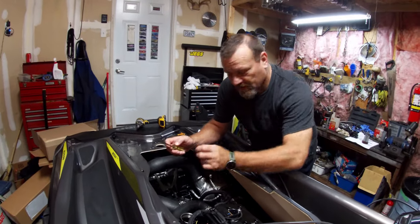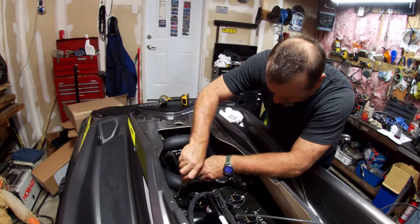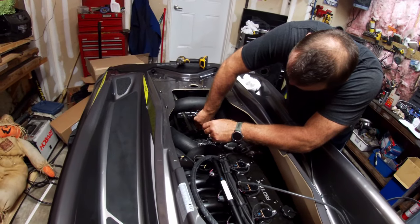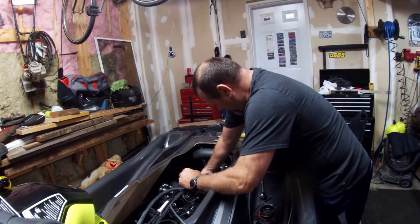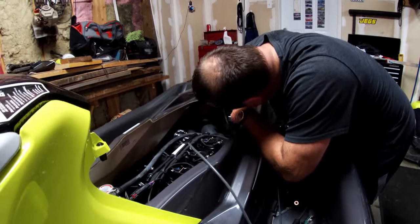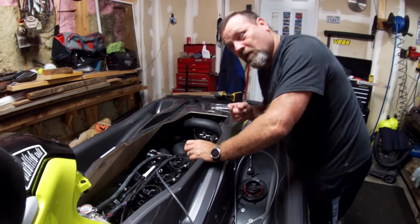While we wait for the oil to draw, we're going to come through here with a screwdriver and check all the hose fittings — make sure everything's tight, so in the spring we basically just add water. One of these cooling lines for your exhaust can come off and you are going to sink so fast. Tighten up hose clamps, tighten whatever you can reach. It's a good opportunity — if you were to take it to a dealer you'd hope they do this type of maintenance for you.